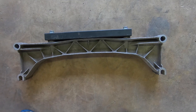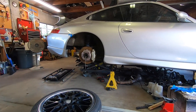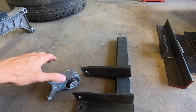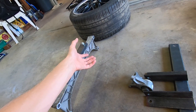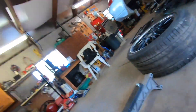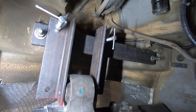Here's the rear mount bolted together — it's got two washers in here. In the front, in order to get the motor where we need it front to back on the car, off of this front mount I'm going to have two pieces that kind of go like this and house a mount. There's going to be a lot of torque — when the motor is accelerating it's going to want to twist, so it's going to put a lot of stress on both of these motor mounts. This is kind of my first go at this. I didn't really do anything off of CAD because I don't really have a model of the underside of the car, so I'm just kind of roughing this in.